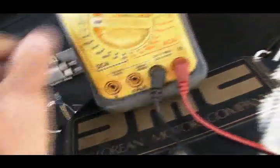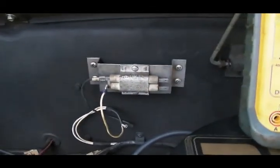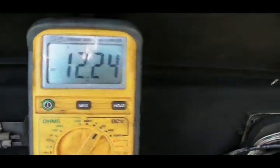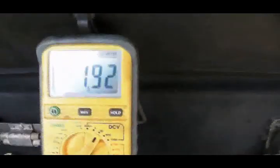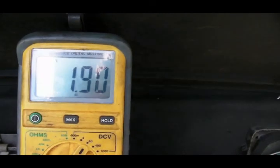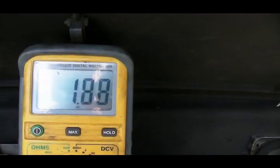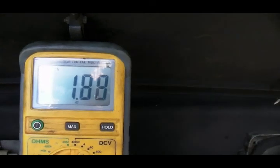First I'm going to show you voltage into the coil. My resistor grid is not active — I'm just using the common terminal as a junction point — so into my coil I have full battery voltage. But on the negative side of the coil, I'm getting basically the same voltage that I was getting off of the Bosch blue coil. My ignition module is seeing the same voltage no matter whether I have an HEI coil installed or the Bosch blue coil installed. So I do not need to run any kind of special ignition module — the standard ignition module is fine.